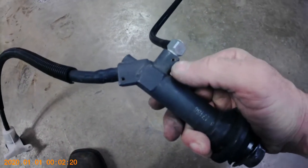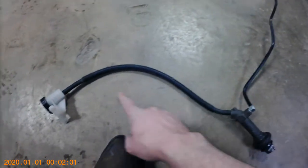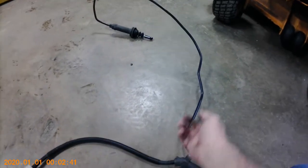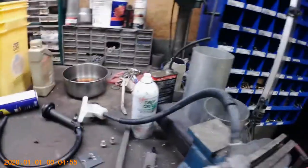So we're going to have to replace the clutch master cylinder. I've already pulled it out of the truck — I'll show you when it goes back in. I'm going to split the master cylinder from the rest of the clutch hydraulics by driving that roll pin out, then that fitting will come out of the master cylinder. The new master cylinder comes with a new hose, and we reuse the reservoir. I'll keep everything downhill so no air gets into the system, since there's no bleeder down here.